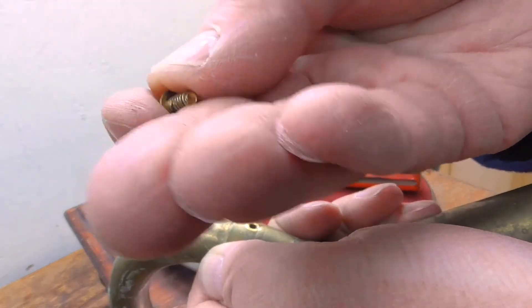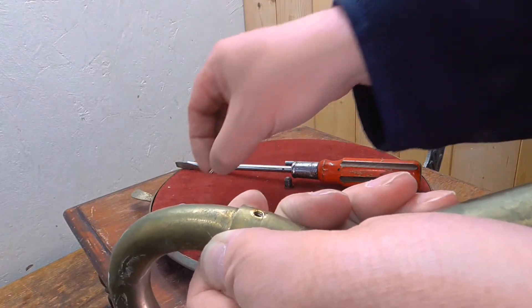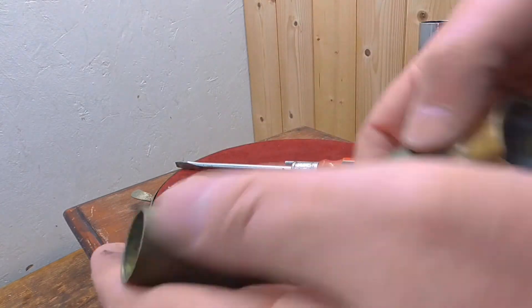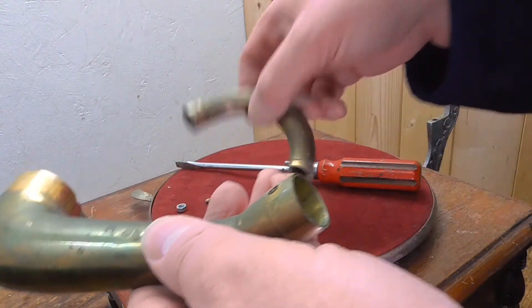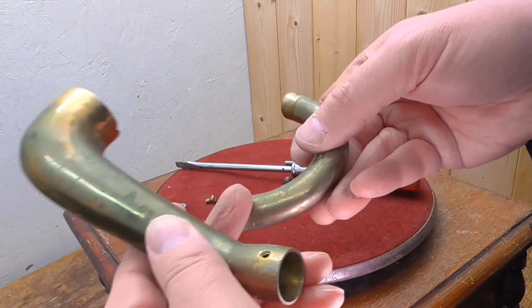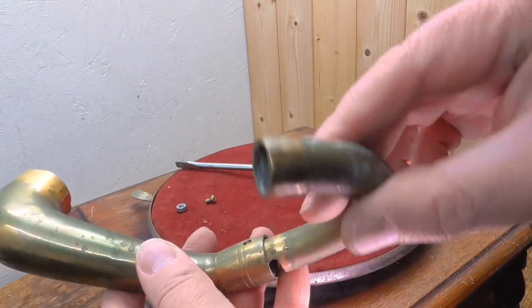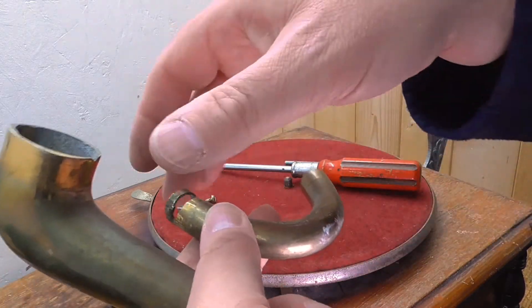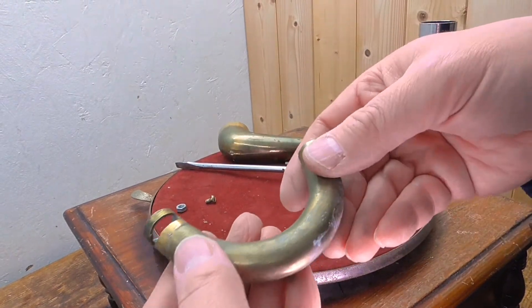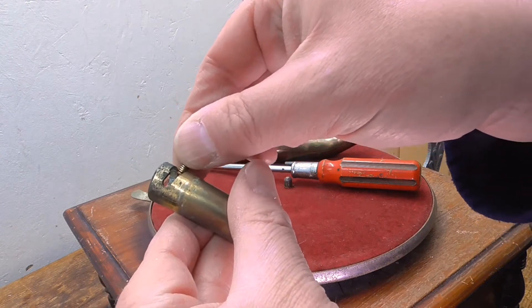Just a little screw there. At some point I'll check the screw threads on these — they don't look like metric ones, they actually look more like imperial ones. You can see that this works basically by having the screw running in this channel here, which allows it to turn over but only to a certain point. But that channel is very crudely filed — I bet that's been done by hand, probably drilled out and then filed out by hand, and the screw just slops around all the way in there. So that's probably fixable.